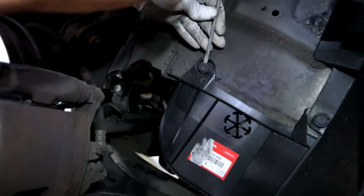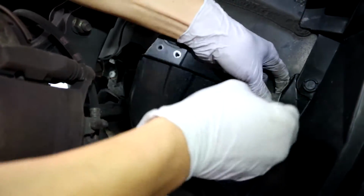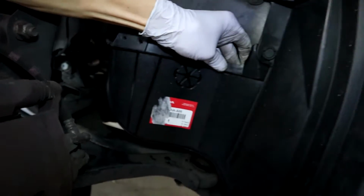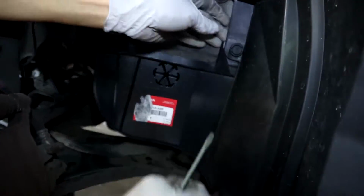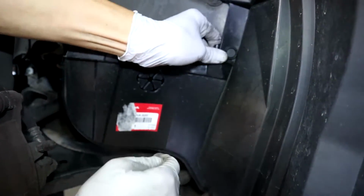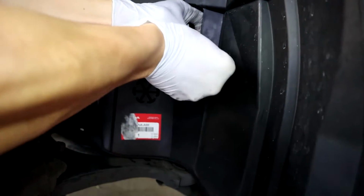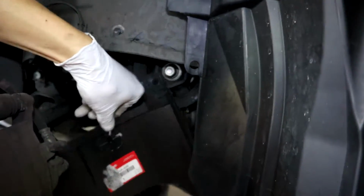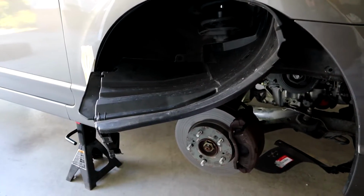So the first thing you want to do is take off the two clips that hold this piece in on the passenger side wheel well, so you can get to where the actual belt is. Also make sure you have extra clips around, because you're probably going to break them, like that first one. I just broke that one. I'll have a link in the description for extra clips if you want. Once you get that out, peel that off and you can see the belt.